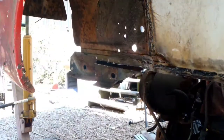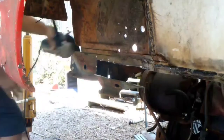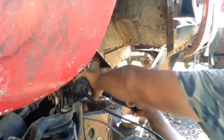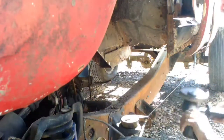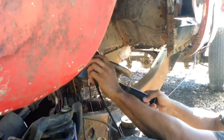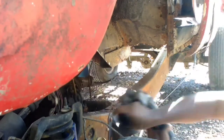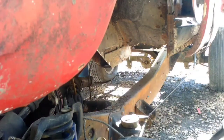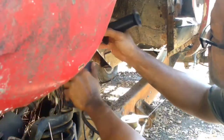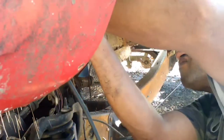Now, before I actually do that, once I'm finally done with cutting the frame out, I could go ahead and weld some metal on the bottom of the open points on the subframe to close in those little box sections of subframe. I want to close it all back in and then move on to welding some type of mount. I have to figure that part out too, and obviously you'll see that when I get to it. I also got to figure out a solution for our bushings on the tabs on the front of the Ranger frame.